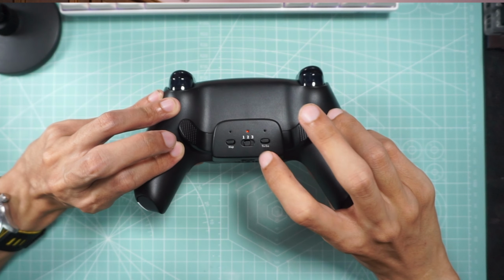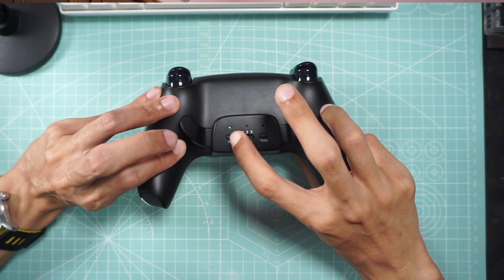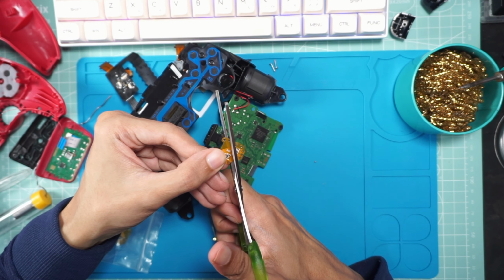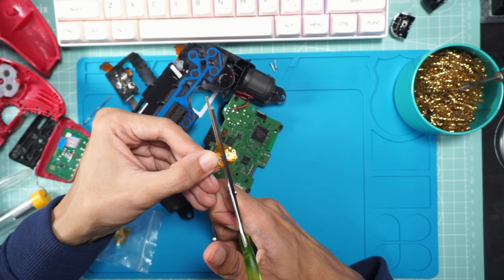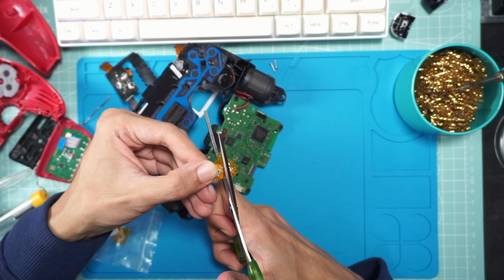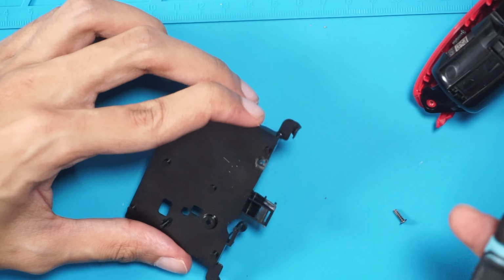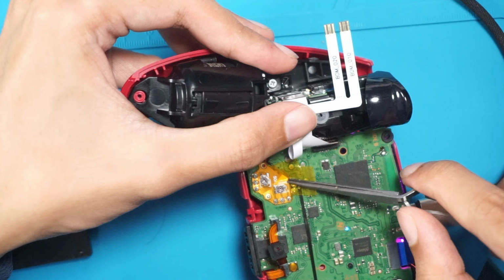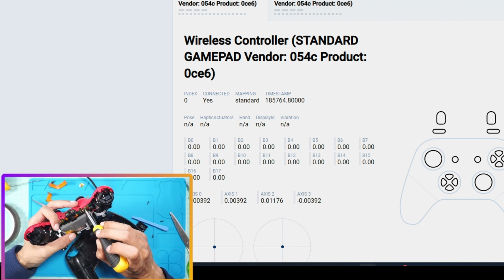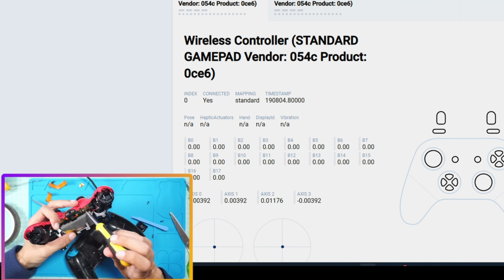When I was doing a test on a back paddle mod from AliExpress, the cell inside my noodles sprung out this idea to try this mod. So I started to work with my red DualSense. For the DualSense, I need to cut it in half because the soldered point for the haptic feedback motor is under the joystick. I also need to cut a bit of the battery holder to make space for the potentiometer to sit. However, things didn't go as I expected. The controller initially has a minor drift, but after installing the drift fix and doing some adjustment with a screwdriver, it goes to the center.